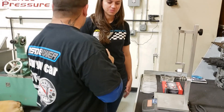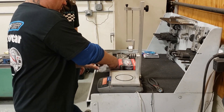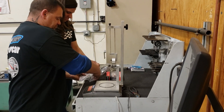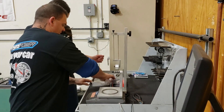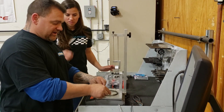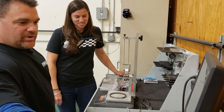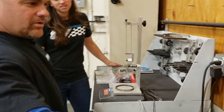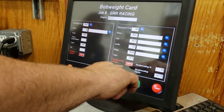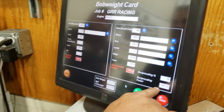When we do rings, we also have to do our expander rail. Here's our rail for the piston — we'll grab our oil ring, our second ring. If you don't know what you're doing, you can't tell the difference between the top and the second ring, so don't mix them up. Our total rings weigh 38.5 grams.